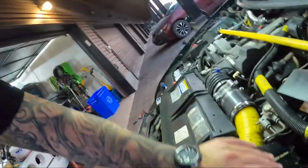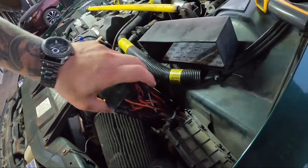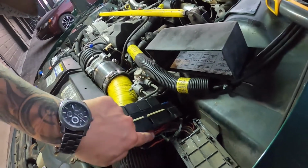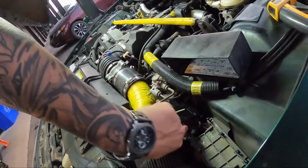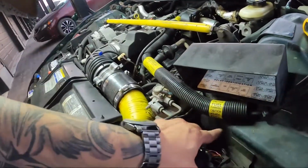So with that in mind, we did notice there was some wiring that was messed with back here. We reconnected wires that were of similar color, and we noticed this power wire here that has no insulation on it. Maybe that touched something up inside the fuse panel. Maybe someone moved it over to get it out of the way and arced it across here. We are leading back to possibly a PCM issue or malfunction. The grounds are good. We just tested those.